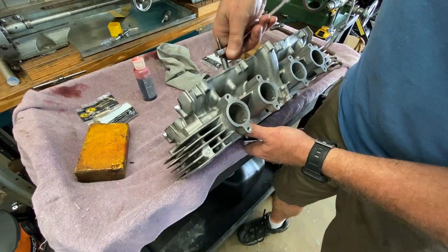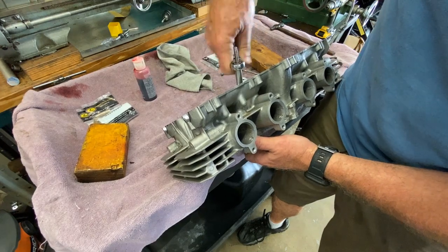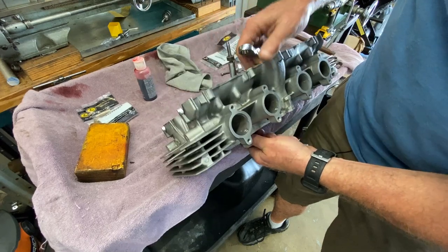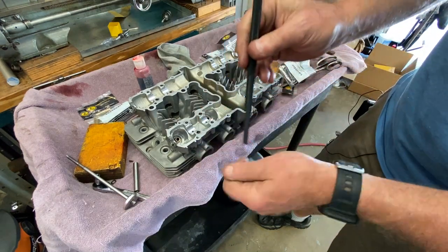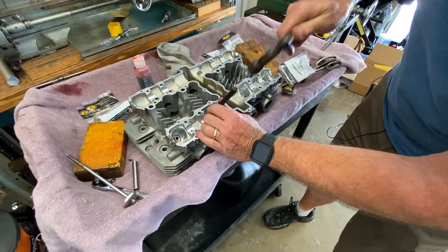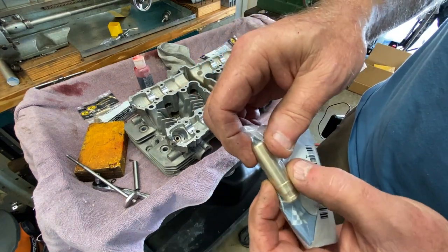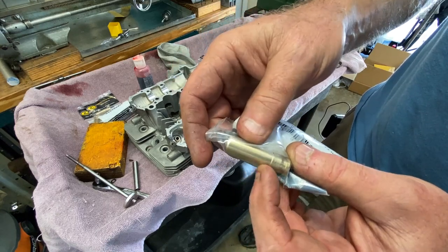She's getting down to the bottom. Now we switch this around and take it off — looks like we got a little damage to the thread on this one. This may be the only other time this tool is going to work. It got hot, that's the problem, even though I did put some oil on it. To check if it's fully seated I take the 7mm driver and give it some hits. That's solid. The reason I do that is there's a mini shoulder machined into it — that's your stopping point so it can't go any deeper.